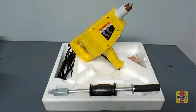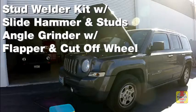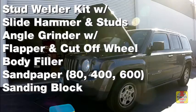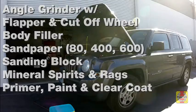The stud welder runs on regular 110-volt power, costs less than $200, and comes complete with a slide hammer and studs. You will also need an angle grinder with cutoff and flapper wheel, body filler, sandpaper, a sanding block, mineral spirits, rags, primer, paint, and clear coat.